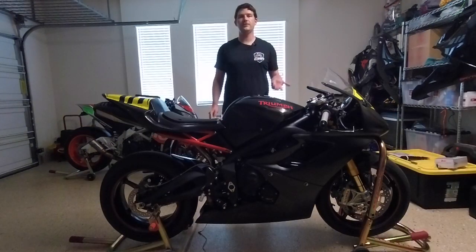Now, before you start working on your bike, I'd definitely take your time planning everything out, make sure that you have all the replacement parts that you're going to need. We're going to need a new cam cover seal, we're going to need a new timing cover seal.